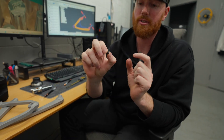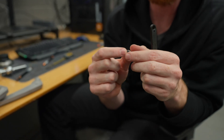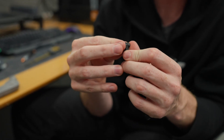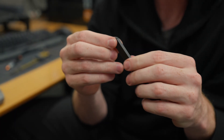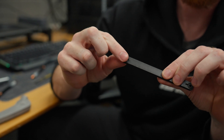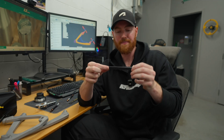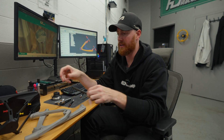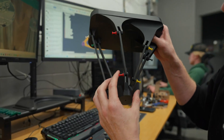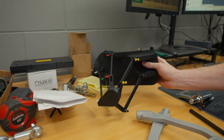It's actually got ball joints — an M4 thread, 3D printed ball joint. I am going to try some metal ones, but the printed ones might be fine. It actually clips in, and it's a really smooth ball joint — smoother than I thought it would be. So this would connect at two ends and function a lot better. When you get to extreme ranges with the pins, these arms require articulation, and it basically needs to be a ball joint for it to properly simulate.